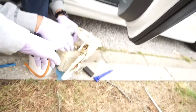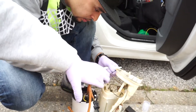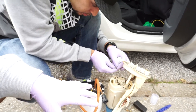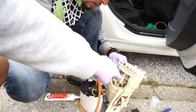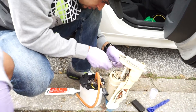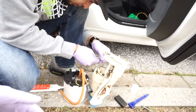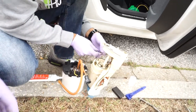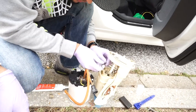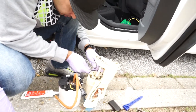Worst case scenario, ride it out for a little bit — the second it acts up again, get a brand new fuel pump. Everybody's probably gonna roast us for this, but we're pretty much gonna do a temporary fix. We're gonna put a little bit of silicone on that corner, try to clean up the connectors as much as we can, and tighten them up so that makes a good connection. What's happening is fuel is getting up to the top. We're gonna do the silicone sealant all the way on the sides — and hopefully that keeps the fuel out of that little cabin. It's just a temporary fix until he goes high pressure anyway — Stage 2 plus. Eventually we'll switch to that, but for now this is just a quick fix so he's not getting stuck out on the road.